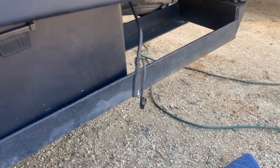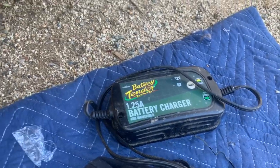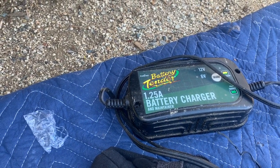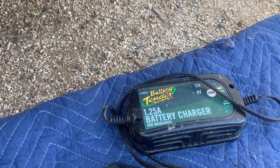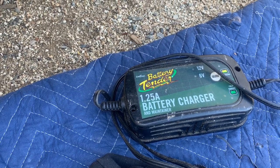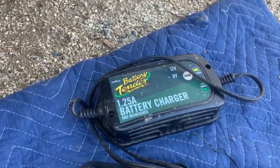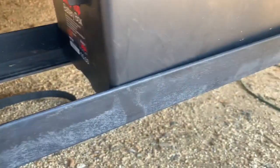On the end I've got my pigtail for the battery tender. I use an inexpensive 1.25-amp battery charger. The reason is that 1.25 amps charges very slowly, which is good for the batteries — charging too fast is also detrimental. You might ask how this works with three batteries, but since they're in parallel it still sees essentially one battery, just three times the capacity, so it takes longer to charge. We're really using this just to maintain the charge, keeping the batteries fresh and preventing premature wear. Now I'll put the lids on, add tie-down straps to each battery box, and show the finished result.